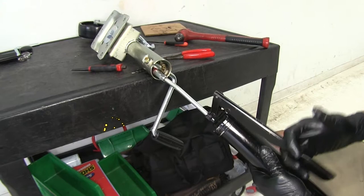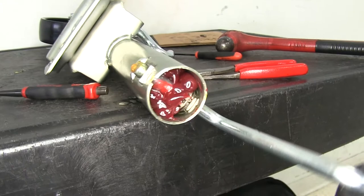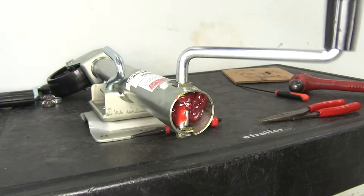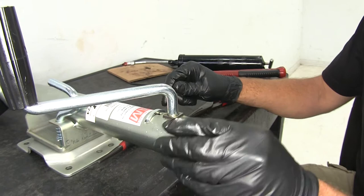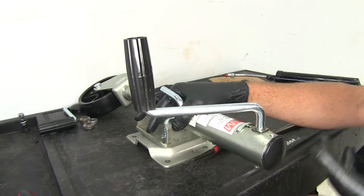To protect the gears, fill the jack with a nice high-quality grease — at least as much as was in there before. Rotate the assembly to make sure it fully engages and coats the gears. You can see it's back to really smooth operation. Now slide the cap down and push the top in, then replace the little screw. And that's it — just a couple parts and a few hand tools, and you can rebuild your jack rather than doing a complete replacement. Click the link below to shop, learn more, or visit us at eTrailer.com.